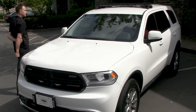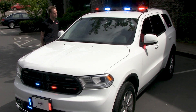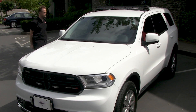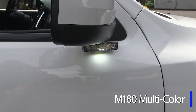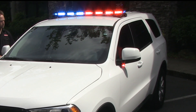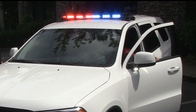Cruise lights — this can be used in a lot of different situations. I have two levels of cruise lights. The first is the top bar along with the vehicle lighting. I also have a level two cruise lights which takes out the top bar — it's a little more incognito. On one button, I have my puddle lights connected in, which gives the officer about a five-and-a-half-foot semi-circle to the left and to the right of the vehicle. When the bar's in full operation mode, I've also programmed a timed output so that end of the bar kills for eight seconds to help preserve the officer's eyesight at night.